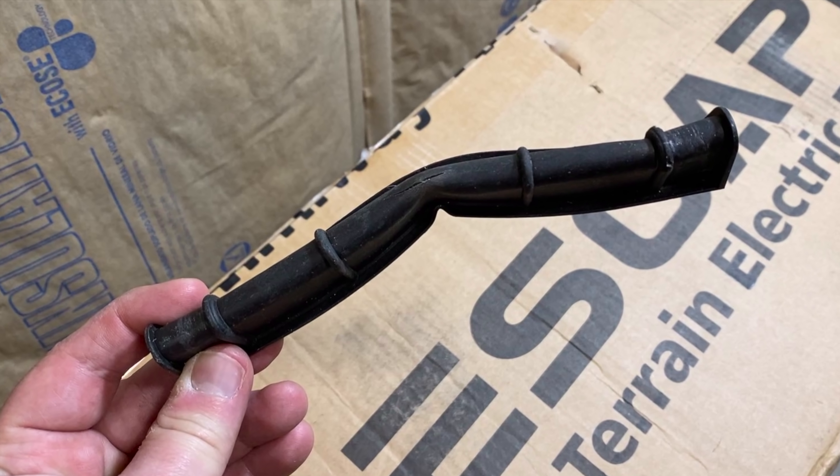The back half of this alloy moped-style frame has a bench type saddle. The Hemiway branding on the back is just like old Honda mopeds. There's a wood covering on the rear rack, which is tubes on tubes — plenty strong. Everything is built to motorcycle caliber, including the dual rear coilover shocks. The fenders are very thick plastic covering front and rear. The drivetrain has a Shimano Altus derailleur and a seven-speed freewheel, beside a rear hub motor at 750 watts. Up front, a single chainring with 170-millimeter crank arms and Welgo alloy pedals.